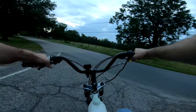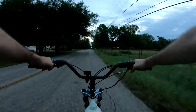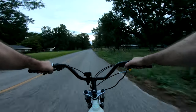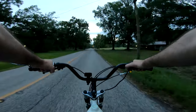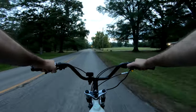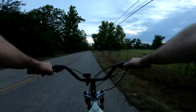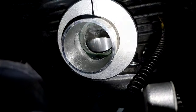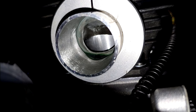My second issue was a bit of an oddball. The motor would run perfect, idle smooth and stable, then all of a sudden would just die. Now I can't say for certain, but I think I found the culprit, and it has to do with my non-optimal intake. A radiator hose isn't exactly ideal, especially given how much volume it puts into the intake. I noticed when I took off the hose that it looked like fuel was pooling up in a small puddle between the intake adapter and the intake port.